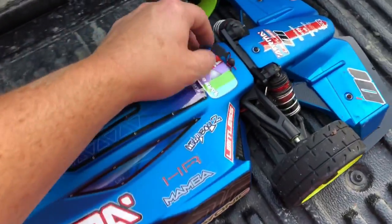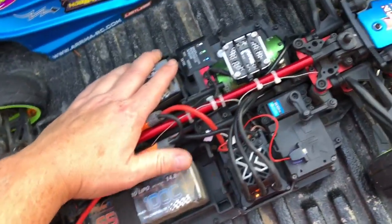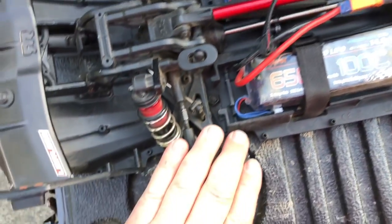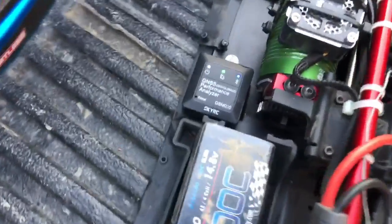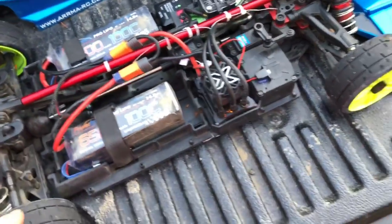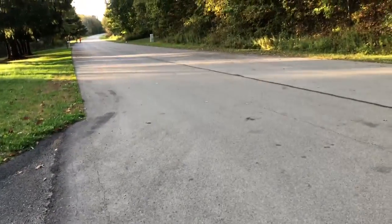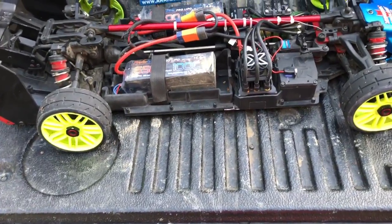114 was it again — it seems to be the top speed on this thing at the moment. The motor is a little warm, not terrible, but can't keep your hand on there very long, so I need to let it cool down. The tires got nice and hot and grippy. I guess it's time to start working on gearing. I currently have a 35-tooth pinion on here. I do have a 38 or 39 at home, so I might have to try that. Now that I've got a proper place to run this, I can start working on gearing to get it a little faster.